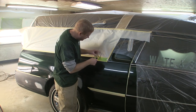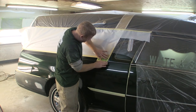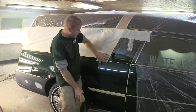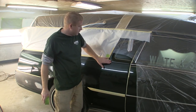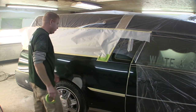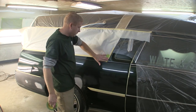Big thing I find: if you're going to burn a clear edge in, don't mask it off hard. That smooth transition tape helps if you have a straight line you're going to do a burn-in on, to try and hide it. Then you pull that transition tape off right before you spray the solvent melt on it.